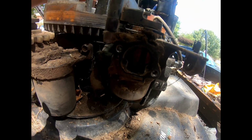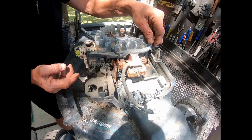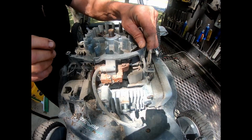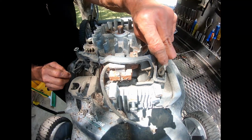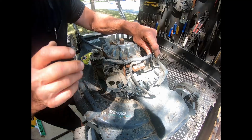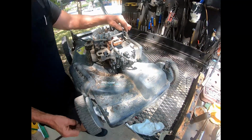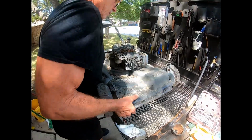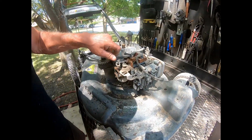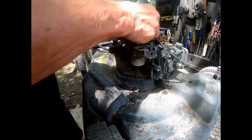So it's closed, pull the rope, it chokes the gas up, it partially opens. This mechanism warms up the spring, it expands and pushes the choke all the way off, and then it opens, it runs wide open. It runs at the governed speed, the speed it is governed to run at. So now we have the carburetor, that's how the carburetor functions.